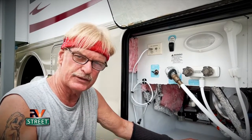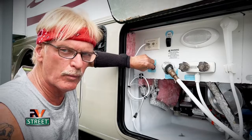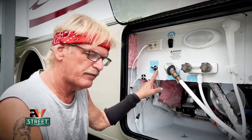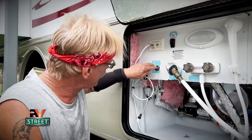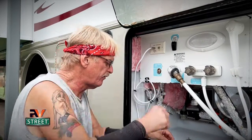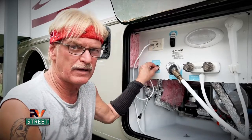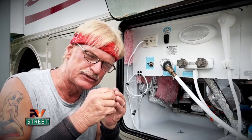I knew automatically that I had a pressure problem somewhere. I was losing pressure somewhere and it would cause that pump to come on, pressurize, and then go off. My first inclination was this normal tank fill valve where you turn it to normal for city water, or turn it to fill the fresh water tank. This was the first area I thought was the problem. It's brass, the original one from the factory. I tried using some penetrating fluid, squirting it in there several times over a couple of days, working it back and forth, because I suspected corrosion was preventing the valve from seating properly and allowing just a little bit of water through.